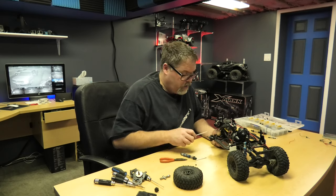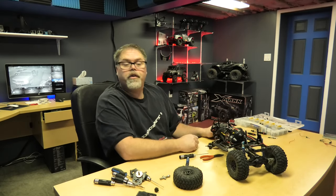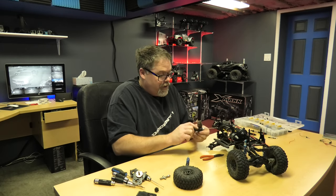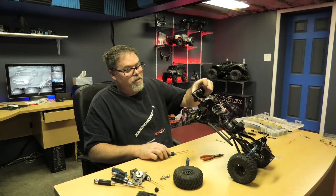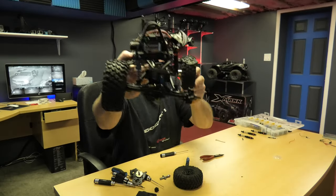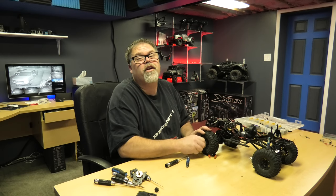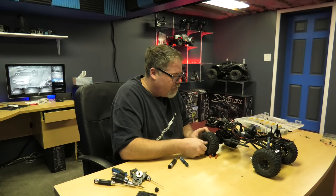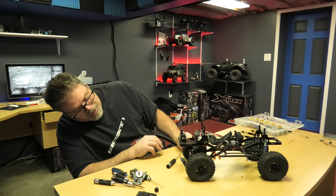Once I get that in there it's not gonna fall out - I'll tell you that right now. There she goes - alright, there's one. Let's go to the top notch and see what it looks like all jacked right up. I know I'm gonna have to change it but let's just see what it looks like for the hell of it. I wanna see what it looks like with full suspension. Look at the height difference boys - look at the height. You can always readjust. A crawl you want lower to the ground if possible but I want to try this jacked-up version. So now we gotta pull this tire off and do the other side, then the truck will sit level.